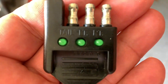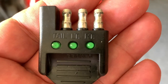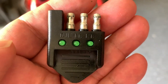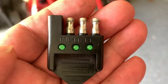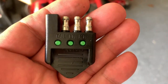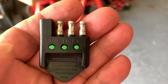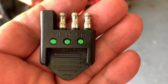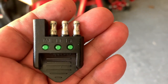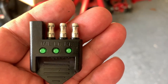So this is the little tester. If you notice, it says tail lights on the far left, left turn signal in the middle, and then right turn signal on the right side. The taillight indicator is going to come on when you turn on your lights, to show that your rear lights are on if you're driving a trailer at night. The turn signals are self-explanatory — if the middle one's flashing, your left turn signal is working correctly; if the one on the right is flashing, your right turn signal is working correctly. If both come on constantly, that's when you're pressing your brake and you'll see both the left and right rear lights come on.